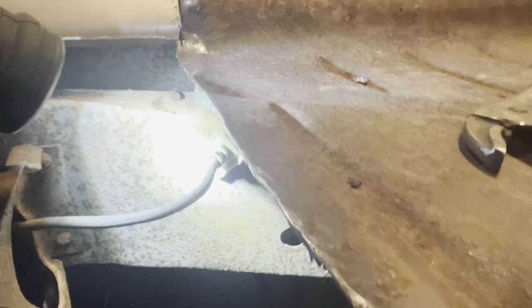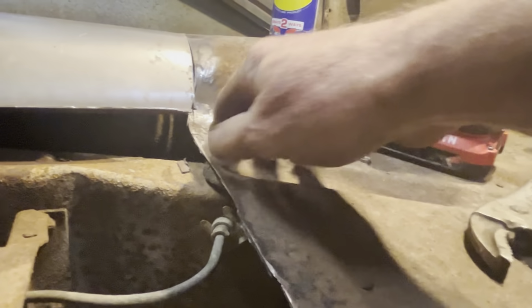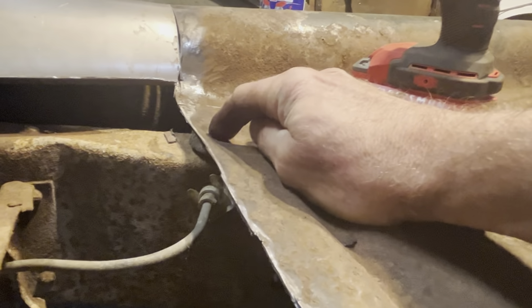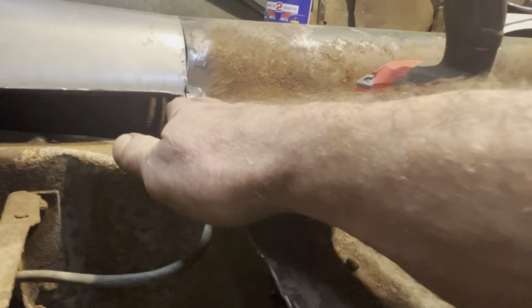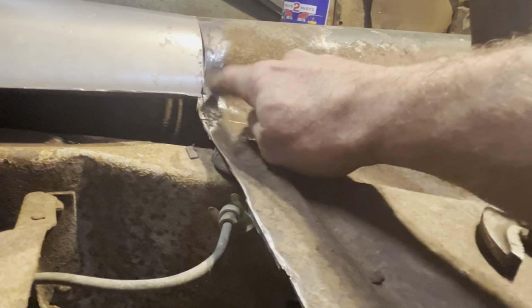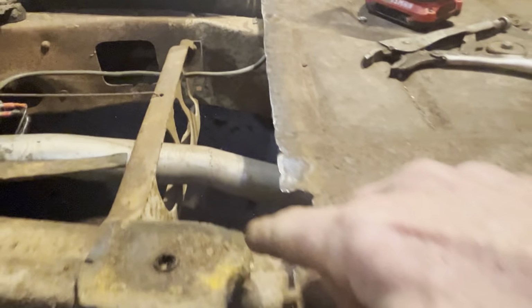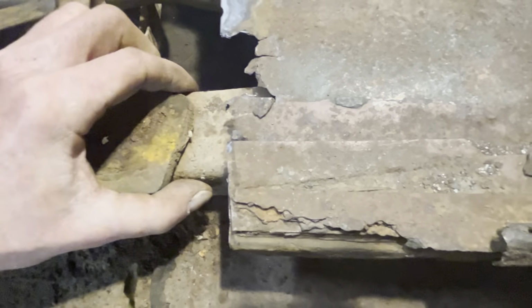See here, guys, there is one of those rubber pads that does not have a bolt through the top. The floor pan just sets on it. That's the pad on the other side that I set my piece of eighth inch on. I slid it up under that and set it on top of the rubber pad. Then I put the bend in it to come up here with the plug weld on each side. I'll do the exact same thing here. I'll overlap here and then get a bolt back through here. But my bolt might not be in exactly the same place as it was before, but that's okay. I'll just peel this pad up and move it. But, yeah, that's where I'm at.